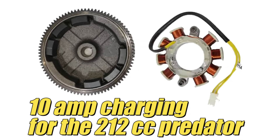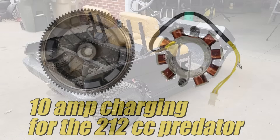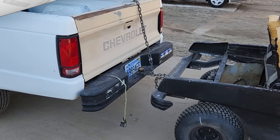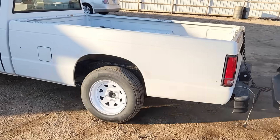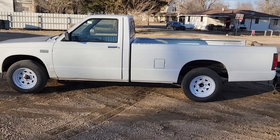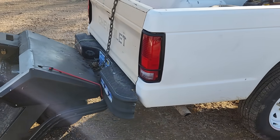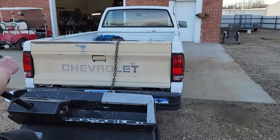In a previous video, I asked if you folks wanted to see us test this 10-amp charging system on the 212cc Predator engine. The overwhelming response was yes, and the parts have been ordered — they should arrive by this weekend, hopefully in the next video. Let's see if the Desperado has enough power to pull a 3,000 pound Chevy truck. Since there are no hills in Kansas, we improvise and do a monster truck pull to show that the golf cart has power on the low end. The little diesel should have no problem doing this — and it did it. That's a relief. Let's see if we can push the truck back. Yep, no problem. This cart actually has more low end power than the fancy red golf cart. Interesting.